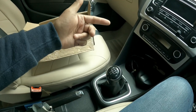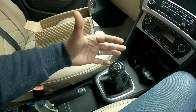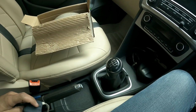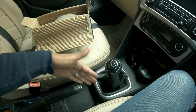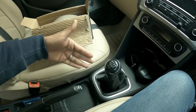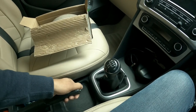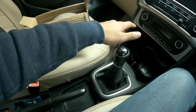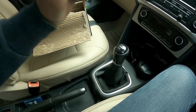One thing you need to keep in mind while working on your rear brakes: you need to make sure that your handbrake is not engaged. If your handbrake is engaged, the brake pads are pushing against the brake drum, which will not let the drum come out. So disengage your handbrake, put it in first or second gear just to stop it from rolling, and now we can proceed.